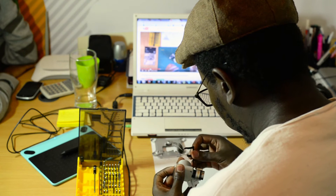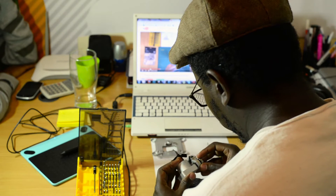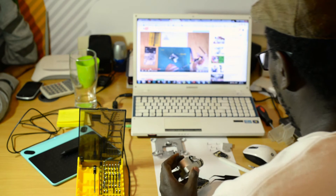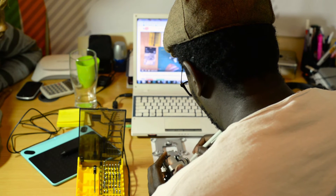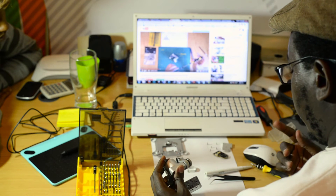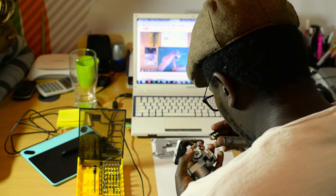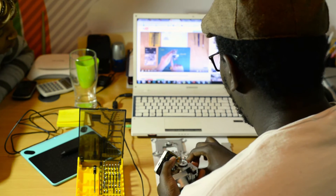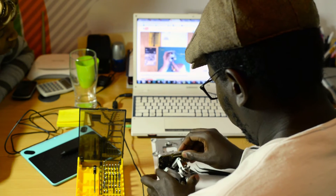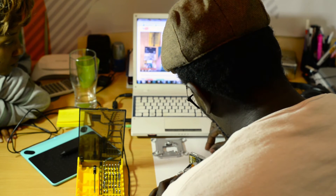Just lift up the lock and pull them out gently. Now you can easily lift up the board and you will see a connector underneath the board. There is also another connector cable that is attaching the board to the system, so you have to be really careful. You can now remove the other side of the motor — this other side comes first so that you can get access to the flex cable as it runs through the round part.